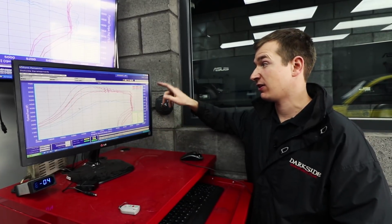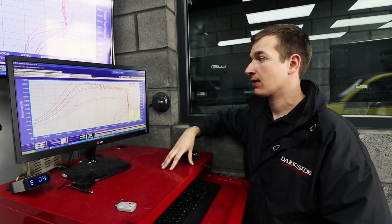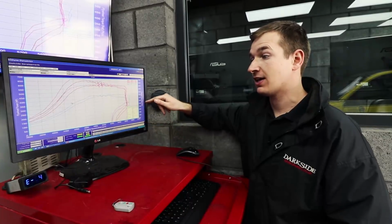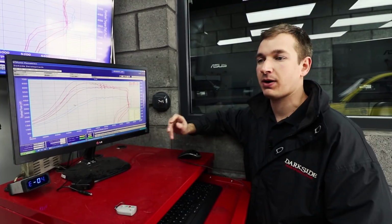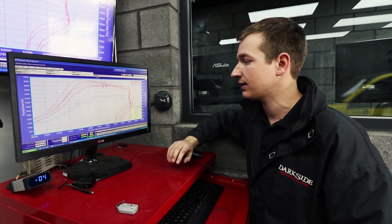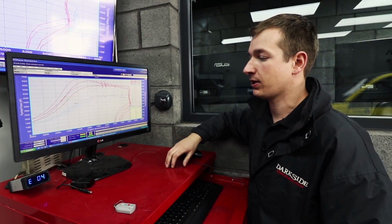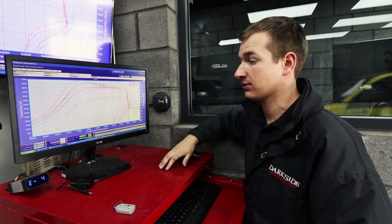And I know, even at this power, if we put on a Dynapack hub dyno like we're using in the MSV Championship, knowing what difference this dyno has to that one, just driving off here with 220 horsepower and you go to there and you do 240 at least. So we know if we put this on there as it is now, we're going to be near 700 horsepower. And then, like I said, we've got tons of headroom in injectors and nitrous system.